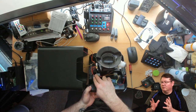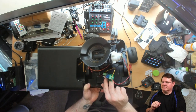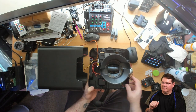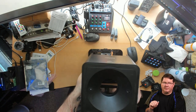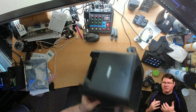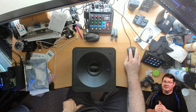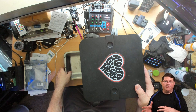I've clipped two sets of wires: one is the incoming power — the little section where that power cord comes in — and I snipped those two wires. I also snipped the second set with the yellow connector, which are the wires that went up to the motor. We'll go over that more in-depth with pictures shortly. When you put it back together, just make sure none of those wires are sticking out at the edges and that's it — it's pretty simple to get in and out quickly. If you've got questions, hop into my forums.